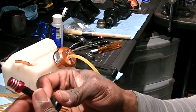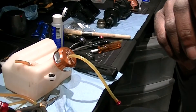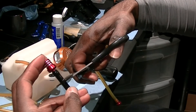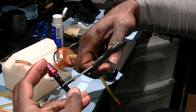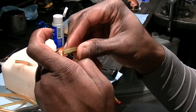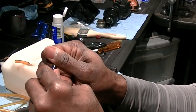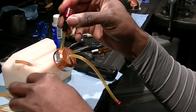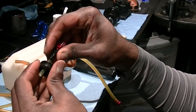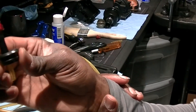Let me bring this back down a little bit because I don't want this tube being this long. So I'm going to pull this out. I want the breather to stick about like so, like that. Then I'm going to meet this piece by pushing that in there like that. This fuel line, once again, it's going to hold. Take the fuel line straight through here, through the grommet, and that's going to connect that. That's going to be my breather right there on the gas tank.